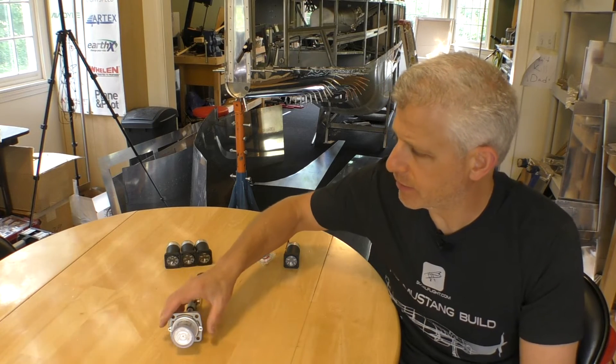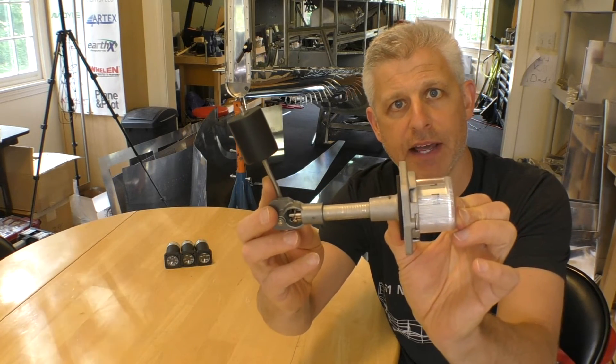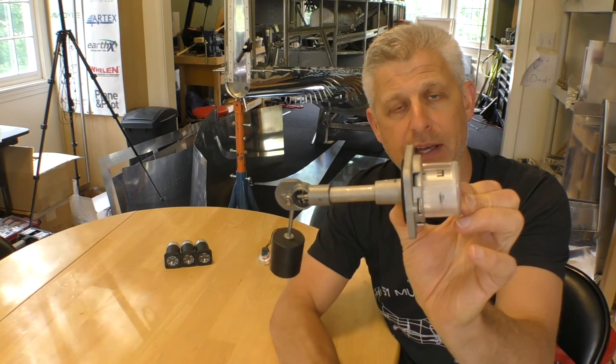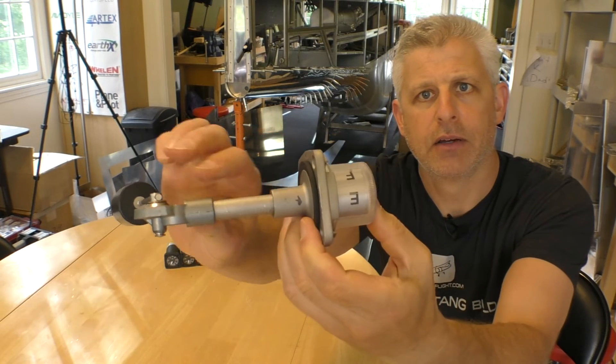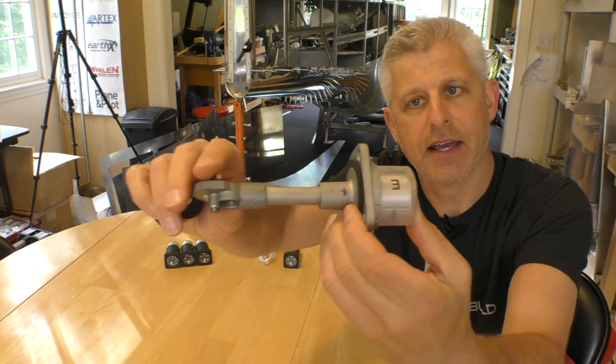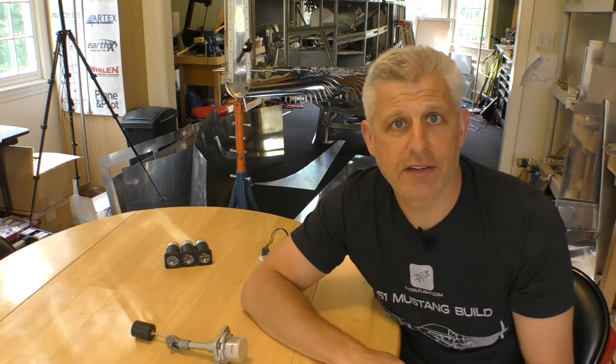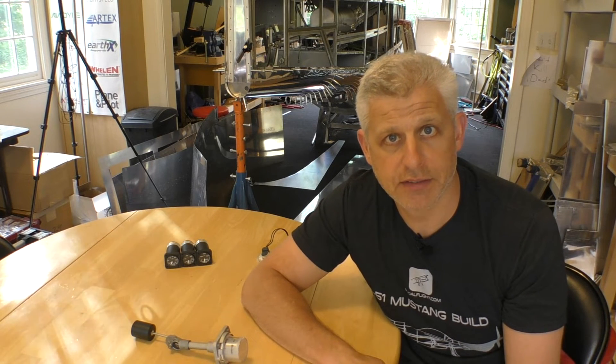Determining the fuel level of the wing tanks is done using a mechanical fuel gauge — here's an example right here. Basically you have a float in the tank, and as that float goes up based on having a full, medium, or empty tank, you have a mechanical readout which you can actually see. It's just a drum that spins with the movement of the float in the tank. This gets mounted directly into the tank with a gasket and screws. It's certainly reliable and very simple, but it does require the pilot to look over their left or right shoulder into the footwell to see the fuel level in the side panels — not all that convenient. So we talked to Titan and they sent us an electronic option.